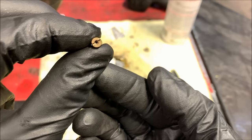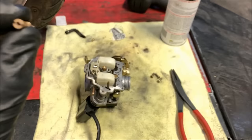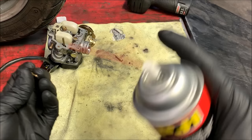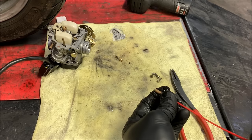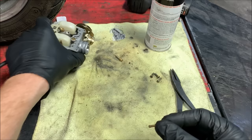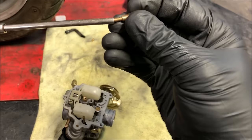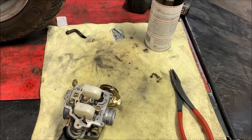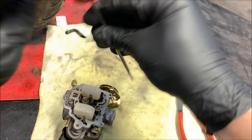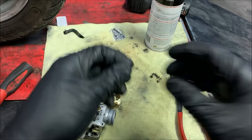Once you see it poking out the other side, run it back and forth a few times. What you want to see is that little bit of light through the middle. You can also blow through it gently with your mouth — if it blows nicely, it's okay. You can also see that it shoots a solid jet stream through there, not a scattered stream. Go ahead and give it a little blast with compressed air in the middle as an extra measure. Compressed air is your best friend for cleaning carburetors — you could probably clean most of a carb just with compressed air and carb cleaner. But if you don't want to do it twice, it's always better to do a really thorough job.